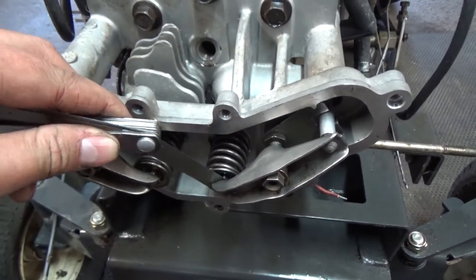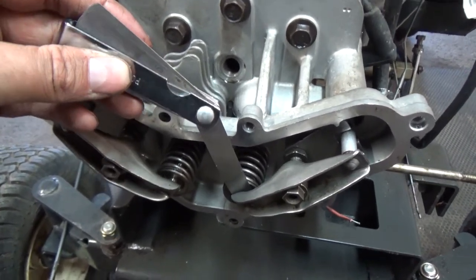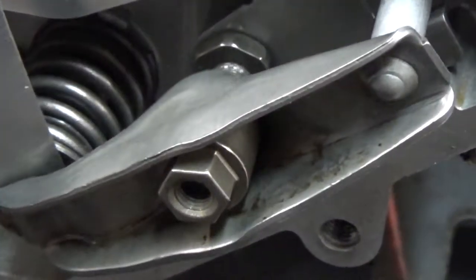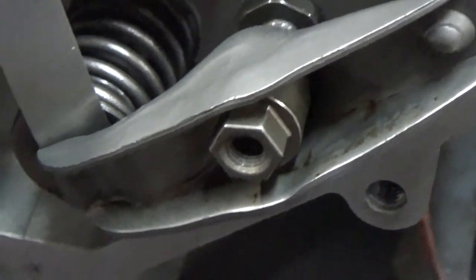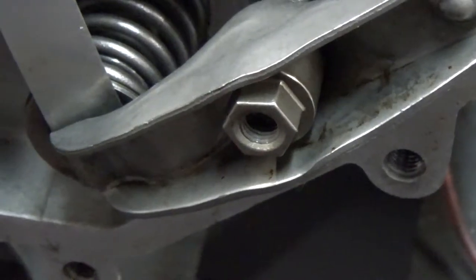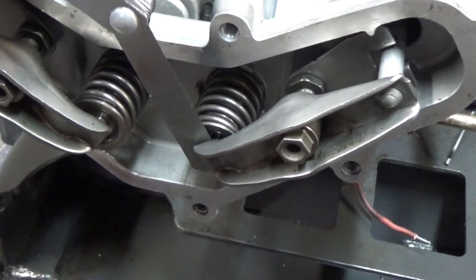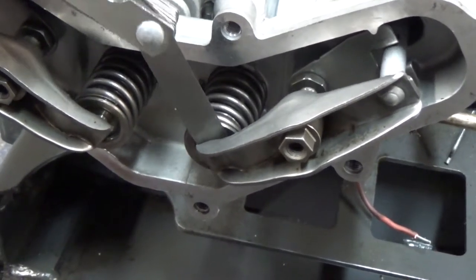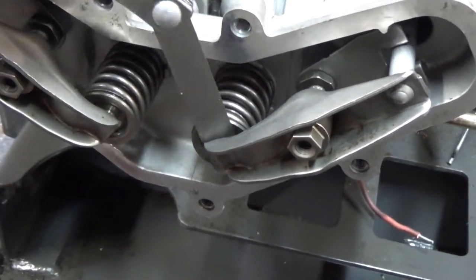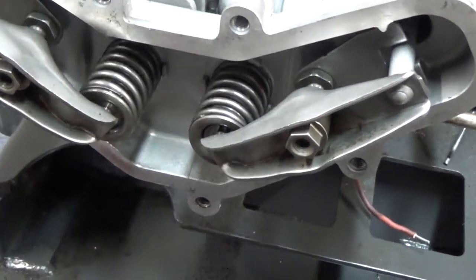You go in here, you hold this 5/1000ths of an inch shim in between your rocker arm and your valve, just like that, guys. And then you're gonna tighten this nut up. And then once you get that nut tightened up, you're gonna go in there and tighten up your set screw, which will hold that nut in place. And you don't wanna crank it down so that this is really hard to pull out. You want it so that it's just a little grabby, okay? You just want it so that you can barely pull it out on your own. But you don't want it loose to the point where it's like this, guys, where it would just fall out if I let that go.